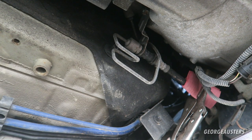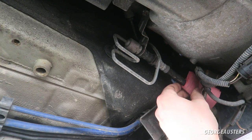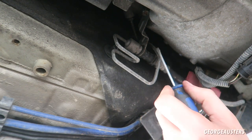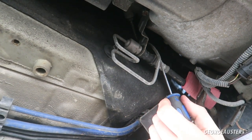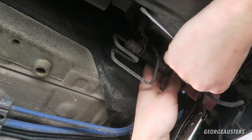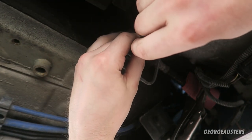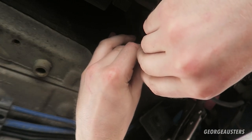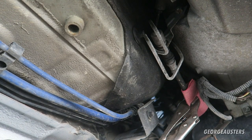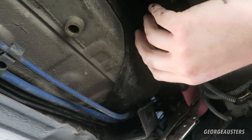What I've done is placed vice grips with some pink cardboard on the hose, just to try and keep as much clutch fluid in as possible. Now I'm going to attempt to remove the clips that hold the clutch delay valve in place. That's the first clip out, and now it's just this one - which isn't that easy because the way you prise the clip off is actually on top, so you can't get to it. There we go, that's the other clip out. Now this should all fall out, but I'm going to get a container just to catch any of the fluid that drains out.